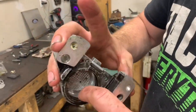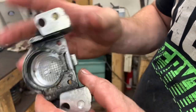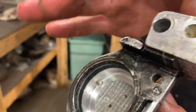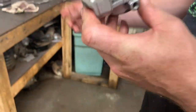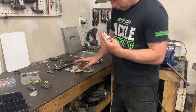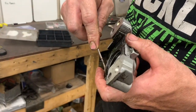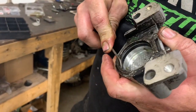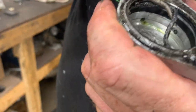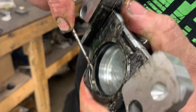And this one you can see, that's your hydraulic seal. This one's kind of like a dust seal. You see the shape of it there? It's all misformed and pushed up out of the groove. Yep. That'd be the bad spot. Well, I'm sure it's bad right around, but. Do those seals come with the kit? Yeah, these seals basically are the kit. Oh, this one's the issue. See, oh, wow. All the crusties and that. Oh, yeah.